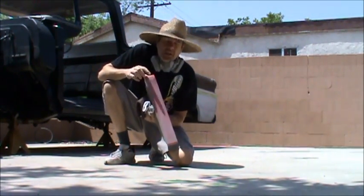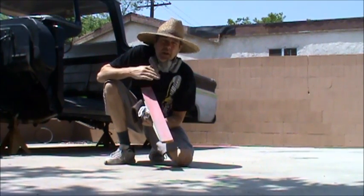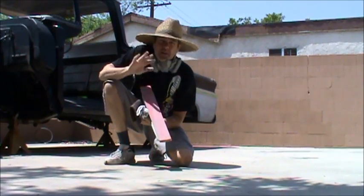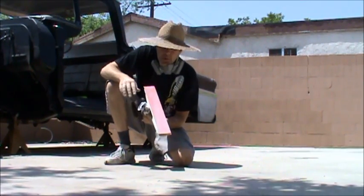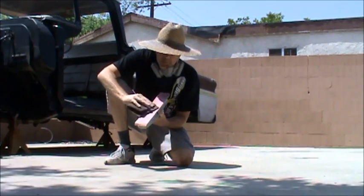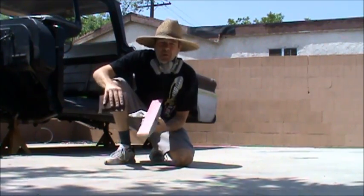So occasionally while sanding, you'll get little tuffets built up on the sandpaper. You want to knock those off just as quick as you can. You can generally see it kind of do a muddy scratch across the primer when they happen. So you just get a little bit of scratch pad and you just get those little nubbies off of there so they don't mar up the finish.